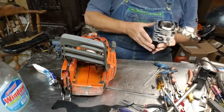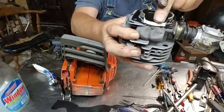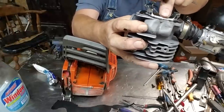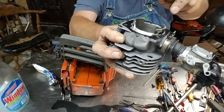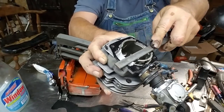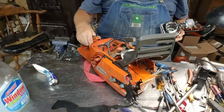One little thing I was going to show you. When you cut these bridges down here like this, because they're quite high, I cut them down. You'll find out, because they're thin, they have a hard time without getting big chatter marks. I use a flat file. I level them out with a flat file. It makes it a little easier on you.